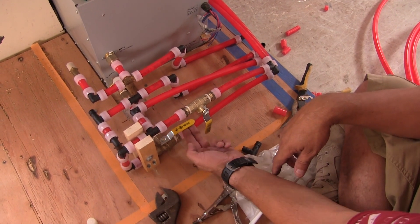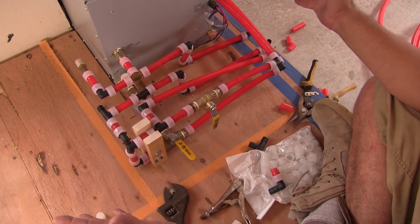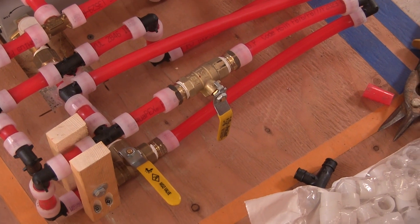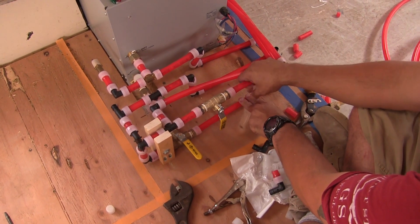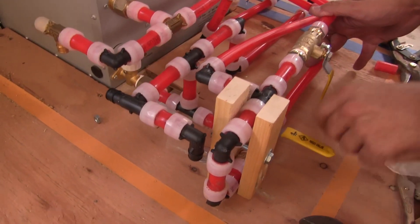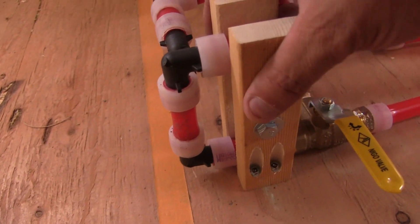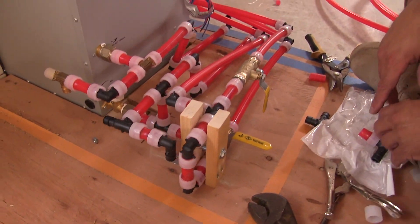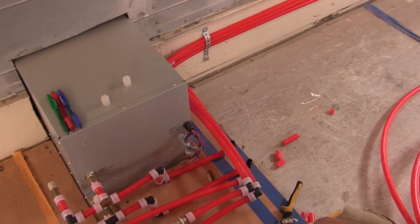We can turn on from pump to shoreline right here, and that's it — that is the spaghetti mess that's here. This right here is just a clamp I built to hold this, and there'll be another one right here just to keep this very, very strong, because we're going to be using these valves quite often. It just clamps the pipes and there are some pocket holes on either side just for support. The lines run along the side of the bus — behind the wall, behind the shower, behind the closet, and underneath the bed.